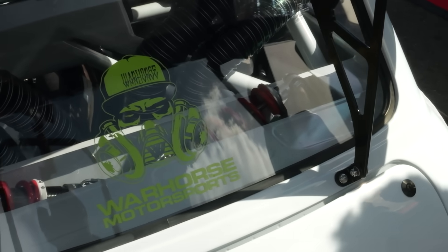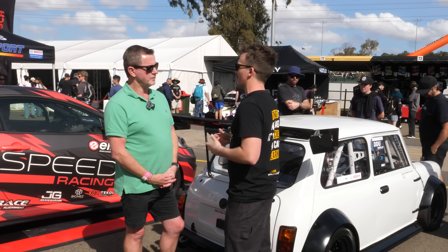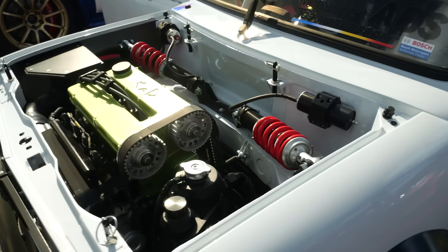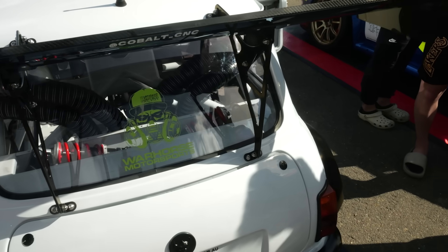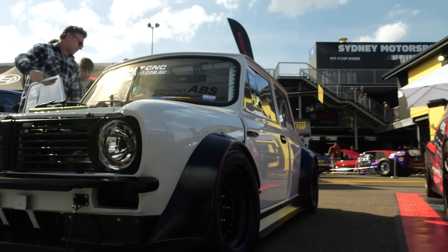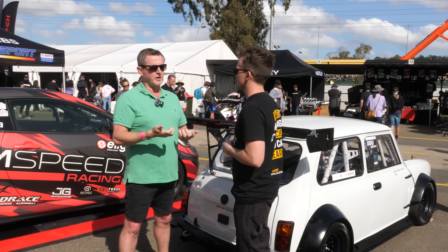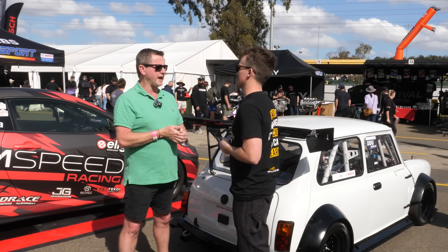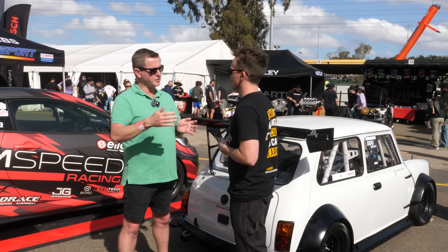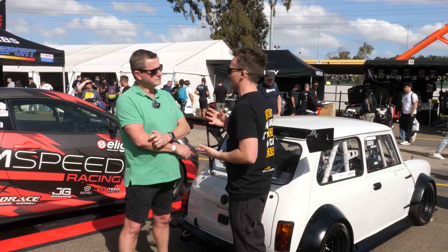One of the most eye-catching things — poking through the rear window and in the engine bay — are the cantilevers and the suspension, and looking at the A-arms it all looks custom. What prompted the cantilever setup? The major reason was physical space. Everything's been shifted upwards into the car to lower the body down. Once we moved everything up 50mm it only left about six inches to fit a coilover, so we went to inboard suspension. Also, anything available off the shelf for a Mini isn't really performance-related, so going inboard gave us far more scope.